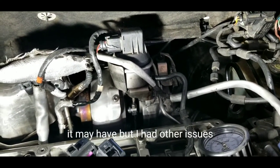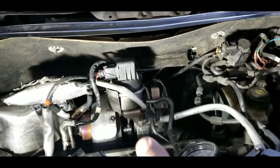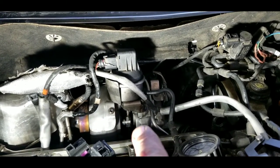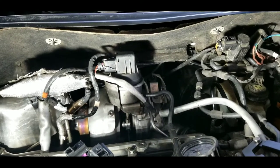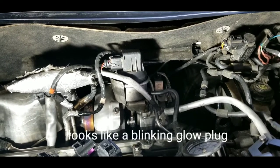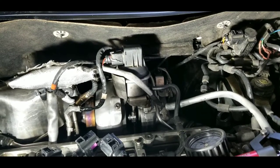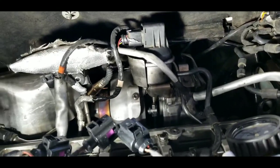What you're trying to do is get the actual boost to match the projected boost. If you go on your VCDS you look up your actual boost and the boost it thinks it's supposed to have, and they're supposed to be the same. There's a way to check both values on the computer - that's why it throws a code. It starts blinking a warning and it's basically telling you there's no boost and it goes into limp mode. I was getting limp mode after I did it that way.